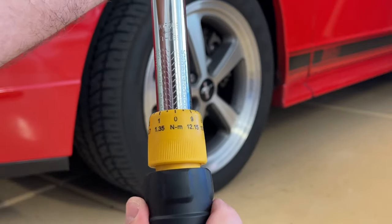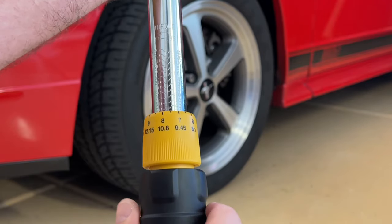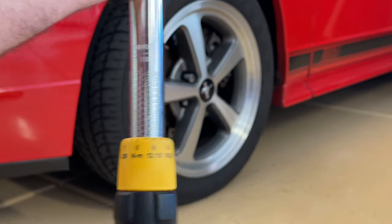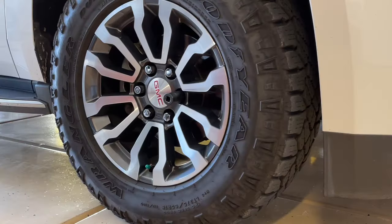When you're done, you do want to spin this all the way back down to zero. It's best to keep it stored with no load on it to maintain your accuracy. Also, don't get in a hurry and overspin it past its zero mark, because that can break it.